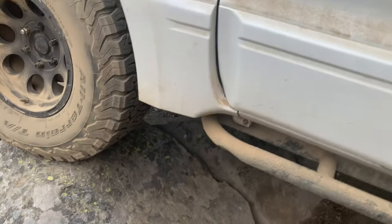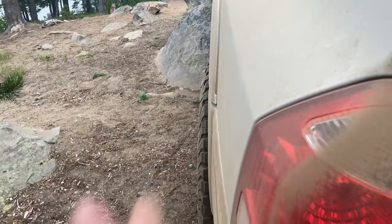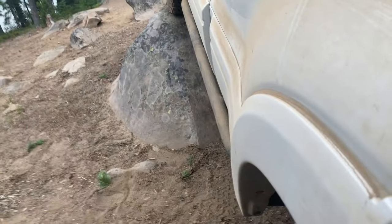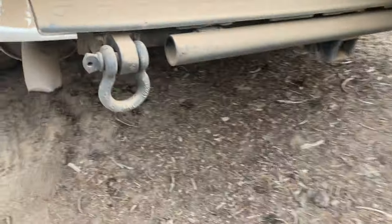As you open the door you can see lights come on underneath — that's factory — so those work as rock crawling lights and are also nice for underglow in a parking lot. I also intentionally spec'd out the tires and wheels so they would be the furthest point sitting off the side of the vehicle. That's for protection — as the vehicle moves back and forth I want the wheel and tire to be the first thing to hit rocks. The sliders also sit proud of the door and protect it.